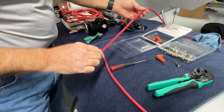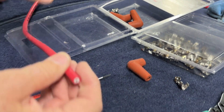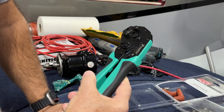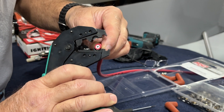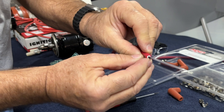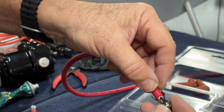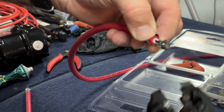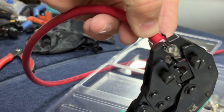The spark plug wire is MSD eight-and-a-half millimeter, made for electronic ignition. One super tool here will do all the crimping you need — it's a Pro'sKit pro crimper, part number CP-371. First we strip the wire: it goes in one spot here, crimp it down a little bit, then twist and it'll come right out. Be careful not to nick the center conductor. Then push the terminal right down in there, making certain the little black center lead stays down inside, and crimp it in the forward section.